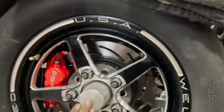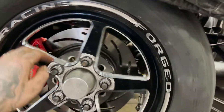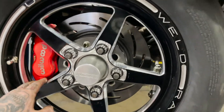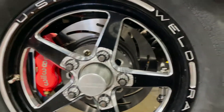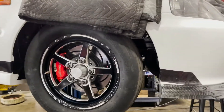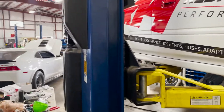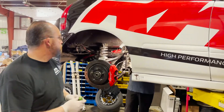The front of this thing is a Strange - it's a Strange front end - and we have Wilwood calipers on it. This is all based off a Corvette C5. In the back we have a 15-inch conversion on it and it came with Wilwood calipers, and we wanted to keep Wilwoods up front. Strange actually made an adapter kit to put the Wilwood calipers on their front end. We used a TRZ K-member from a Corvette and their control arm kit, but we narrowed the control arms to tuck the wheels under the car. In the back we made our own control arms and narrowed it as well.